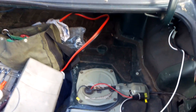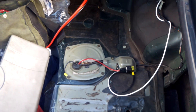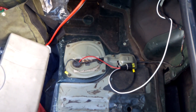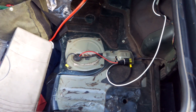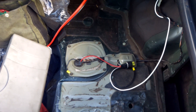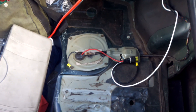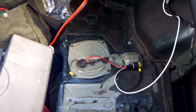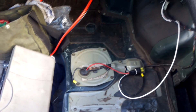In order to make this thing E85 ready, what we're going to have to change is the fuel pump. I currently have a Bosch 044 fuel pump in-tank — I know it's not meant to be in-tank but it does fit — which is a roughly 300 litre per hour pump. We're going to remove that and replace it with a Walbro 450 litre per hour pump. It's actually a smaller unit but it pumps a lot better. I don't want to go surge tank and there's no need to anyway.